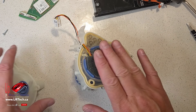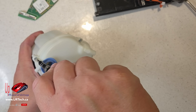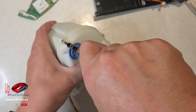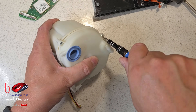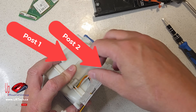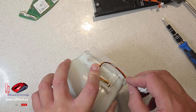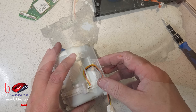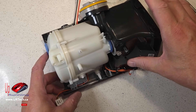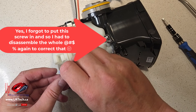So one wire at a time. The foam block back in. Before you finish up, crank these down — this needs to be watertight, you want to keep it sealed. This is what's keeping your machine quiet and you want to make sure that there's nothing rattling in here. There are two posts here — put your wire around. You'll see that there's an arrow here showing you where this wiring harness should go. Put it up on end like this so you can see it, put the guide on and then slide it in just like that. Make sure that is aligned. Now it's nice and tight.